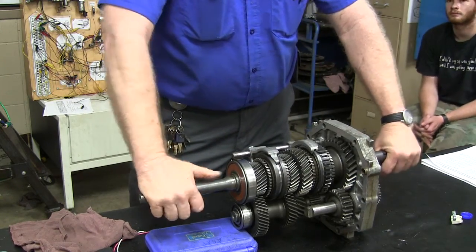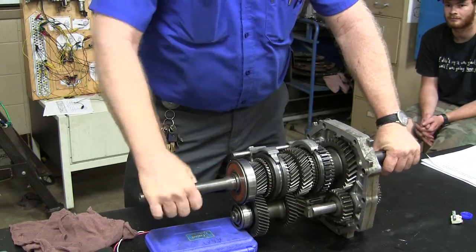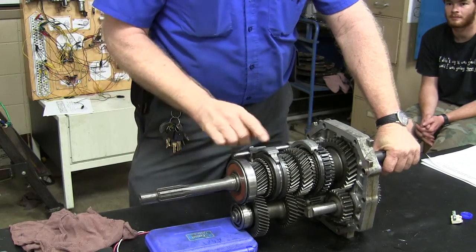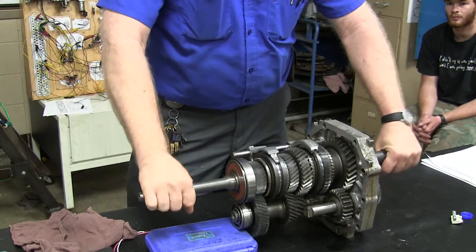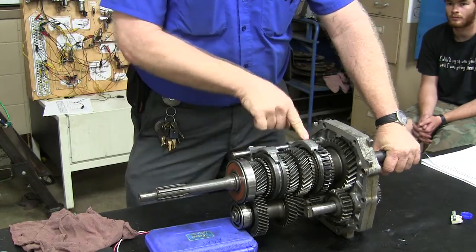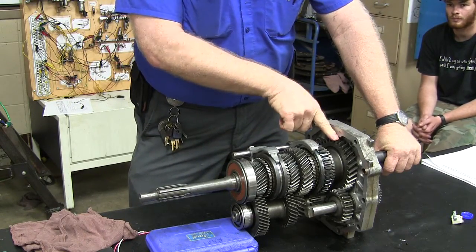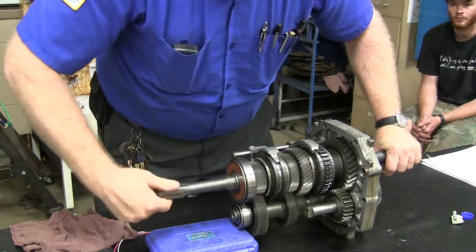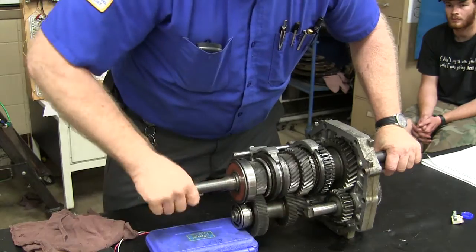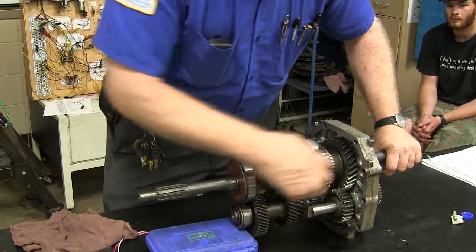You need to move it back towards the back. You just put it in third gear. So you move forward? No, that's fourth gear. If you move this one forward, it's fourth because it locks both these shafts together and gives you your straight through. If you move this one back, that makes this gear the one that's carrying the load. Any time the engine is running, the cluster gear is spinning, even though it's freewheeling every gear on here.